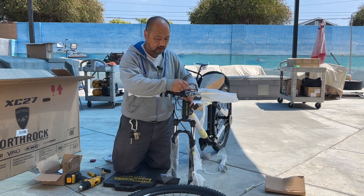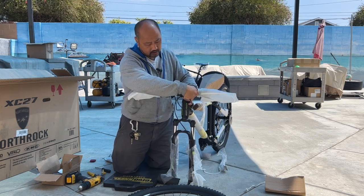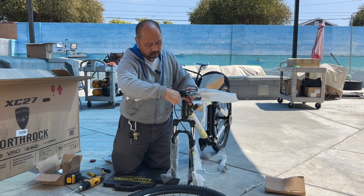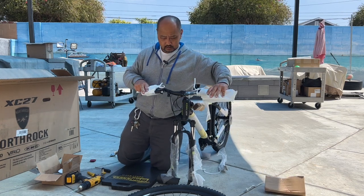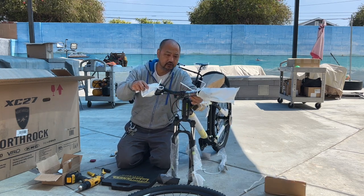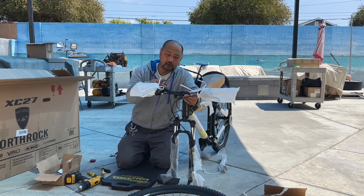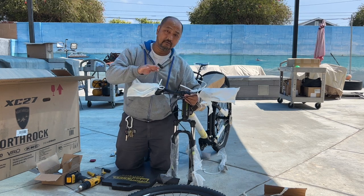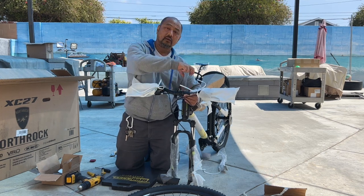I'm actually going to use the hand method. So don't strip the grooves. I'm gonna turn this. So if you notice this little upper curvature, they put these little upper curvatures in so that for those of us who don't like to bend over too far, it's helpful when the handlebar is a little raised. And so I'm gonna have that in that position for me so that I have maximum height on the handlebars. If that still is too far forward when you're riding, because you're old like me, you may have to raise the gooseneck.